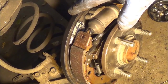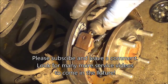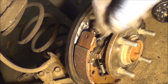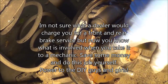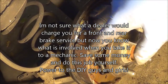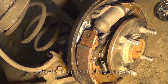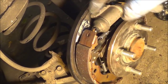Thank you for watching. I also did the rear brakes in the front — the front brake video is also on my website if you haven't seen that one. This should be done yearly because debris builds up in here and will wear out your brakes quicker. If you're not too sure about the springs and how they go, look at the other side because they're all together as a reference point. Anyway, please subscribe, leave a comment, and look for more videos coming in the future. You guys have yourself a good night.